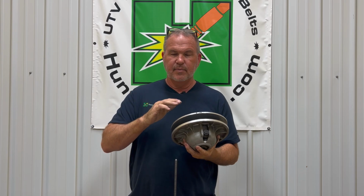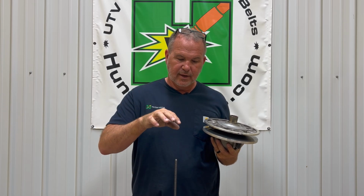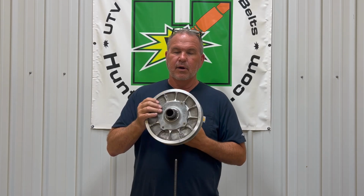And this setup is the Start Fresh with Dalton. So it is going to have a Dalton clutch kit, which contains primary weights and spring. It uses a stock spring for certain tire sizes. And we're including our Less EBS Helix, which we've had forever. It is a stock upshift angle because it is correct.